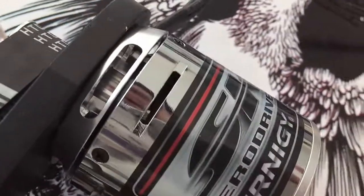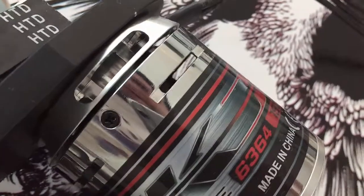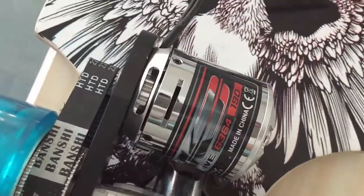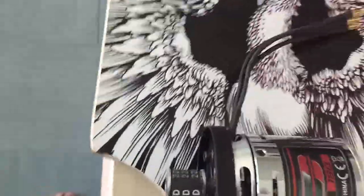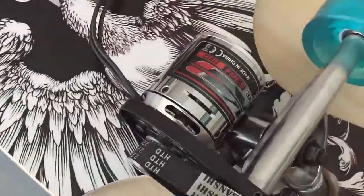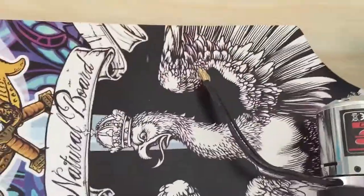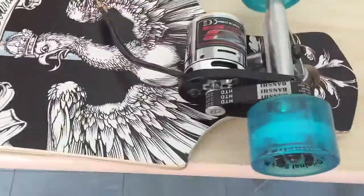I've also gone with this motor — this is the Turnigy Aerodrive, the 190KV, so it's got quite a lot of pulling power. When you're buying a motor for your electric longboard, you do want something that's about 190KV. It just means it doesn't put a lot of strain on the motor and it can put more torque in, so it can definitely get you up a hill — and I am a bit of a lardass.